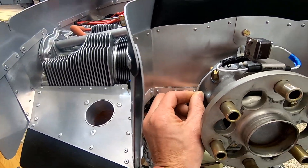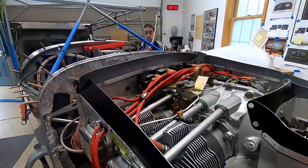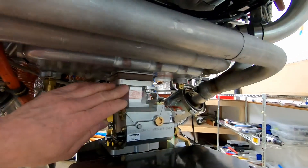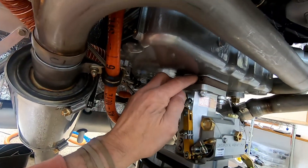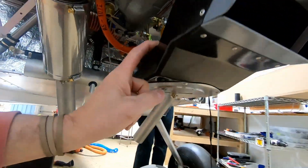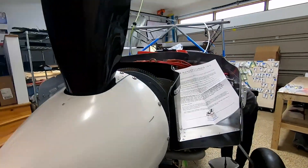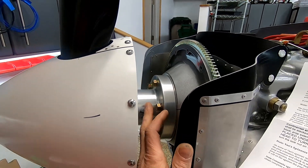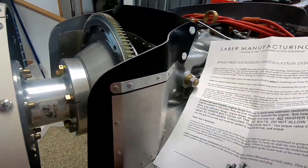I'm going to mount this here, put a P-clip, take that rivet out, and then we're going to put the prop on and the spinner and all that stuff. I got these nuts on - they were fun because they only turn like a quarter turn and there's a lot of tension on them. I've got the gasket, the spacer, gasket servo fuel body, gasket box, and the little spacer in there. Now putting the prop back on - I had it on before but this time it's for real. We're doing the torque sequence: one, four, six, three, five, two - torquing in different increments until everything's tight.